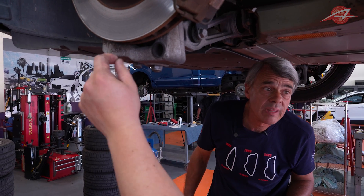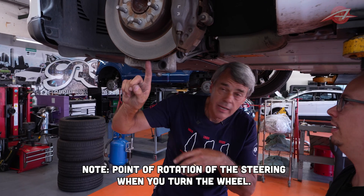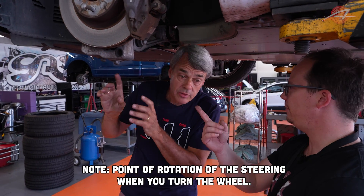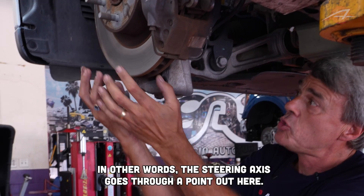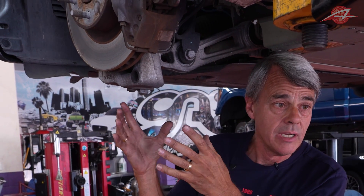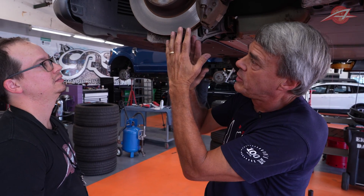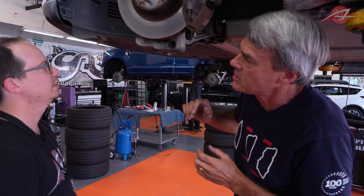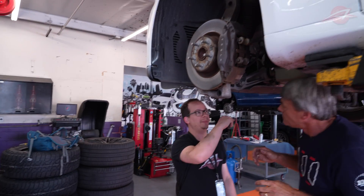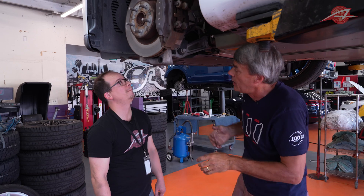So the point of rotation is actually out here somewhere — it's a virtual point of rotation. The benefit of this is that it allows you to pull the whole brake package inboard, put bigger brakes in the same size wheel. And these are big brakes. If you had that ball joint out here, all this would get pushed further outward and would have to shrink to fit inside the wheel. You see this in BMW double ball joints often — BMW was the first to use this in the mid-seventies 5 Series. They had it on a MacPherson strut; here we have it on a double wishbone.